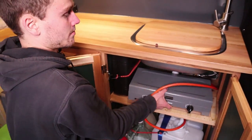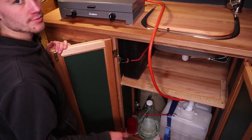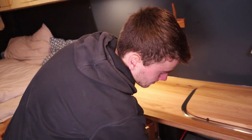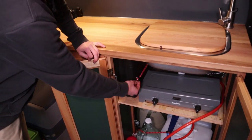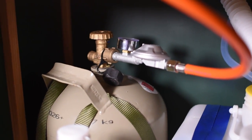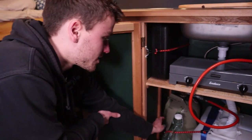I have two cookers — one is always connected so I can just take it out, put it on the worktop, open up the gas bottle and start cooking. I didn't want to install a fixed one because I wanted to leave the workspace free when I'm not cooking. The second one I had to get and install it to register the van as a camper van in Germany — there was some paperwork to get the camper van license. The gas bottle is a standard 7 kilo bottle, fixed with straps through the kitchen frame so it doesn't wobble while I'm driving.